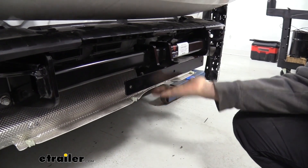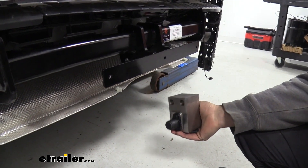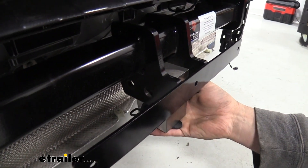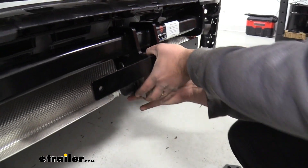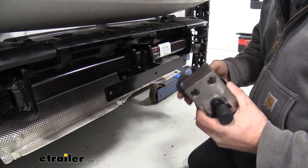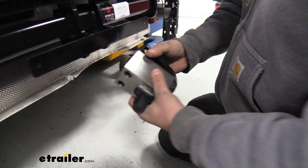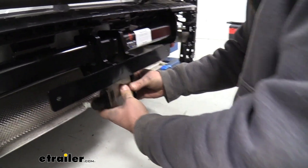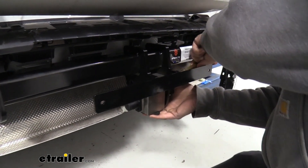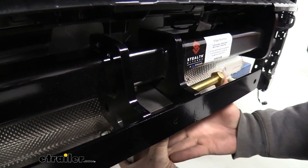At this point, we're going to be ready to put our receiver block in place. If you are using the towing package, there are going to be a few extra steps. But if you're just doing the receiver rack, this is simply going to bolt into place — run our bolts through here with the nuts using a 15/16ths socket and tighten those down. If you are doing the tow package, grab the included hardware — this is going to slide over, you can set that through, and you'll see we have our safety chain loops. Put one on this side, then start working one of my bolts in just to kind of hold it all together. It's a little bit of a handful, but once we get this fed through it should hold it.